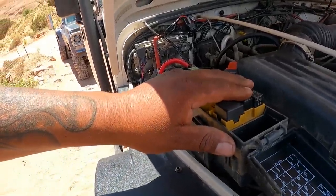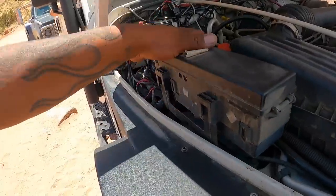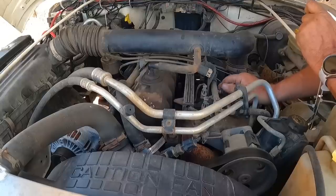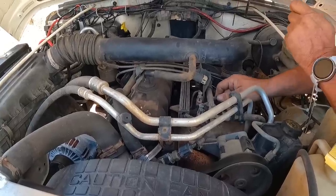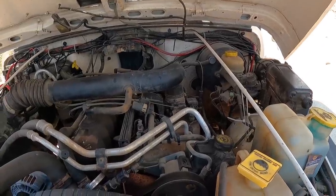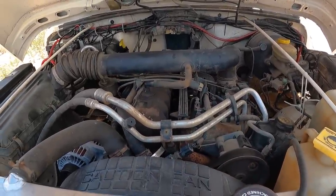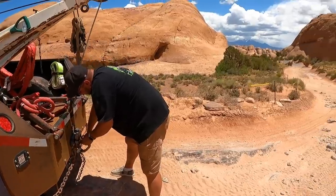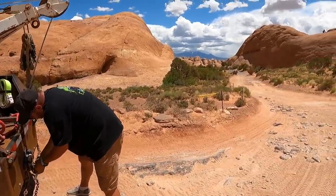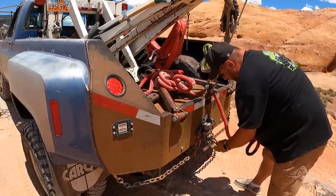Okay. Hold up. The relay's kicking on. Is the relay kicking on? Yeah. Okay. We're not getting anything out of here. The relay's kicking on, so the power's going, everything's working. It's most likely the fuel tank or fuel pump in the tank. So we're just gonna flat pull them out. It's literally right there. Nothing hard. And then get them down to the mechanic shop.